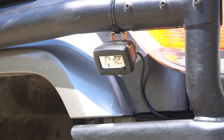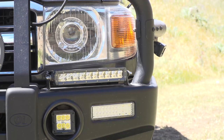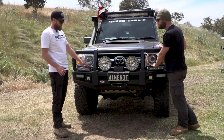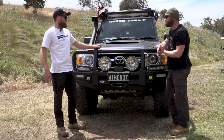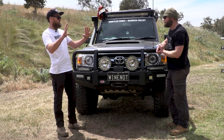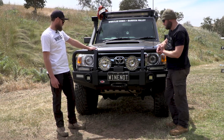I've only just got them. Are these the ultra? Yes. Under the lights here — do these make much of a difference? Yeah, they're really good. If I had my time again I'd probably do a spread beam. These are a spot beam, and as they're angled here the idea is to spot roos coming from just off the verge of the road. But with a spot beam it's quite a concentrated ball of light — I would have preferred a bit more spread. So if I had my time again I'd do the 10-inch spread beam.